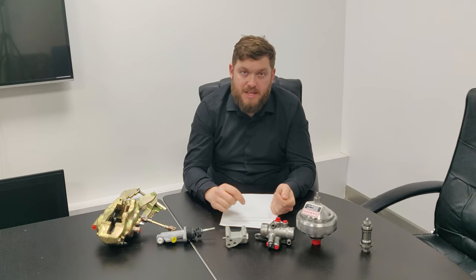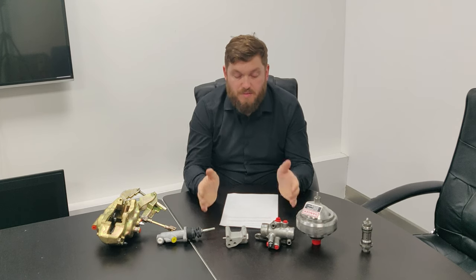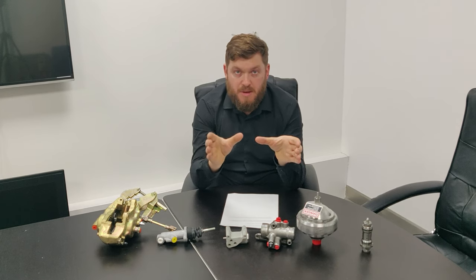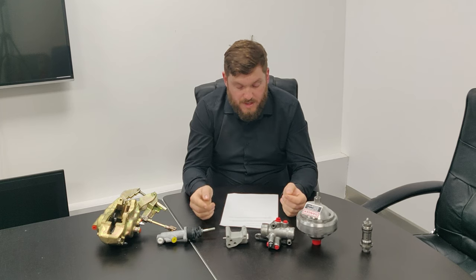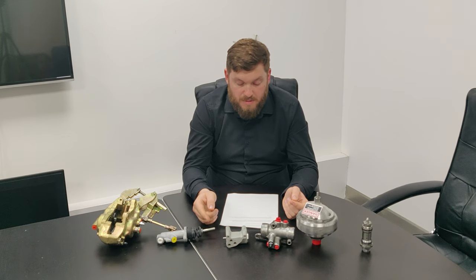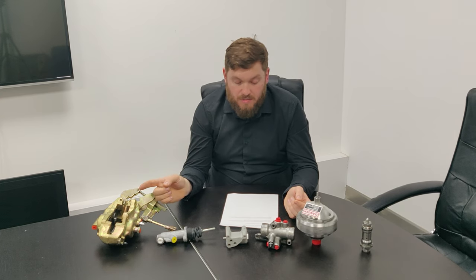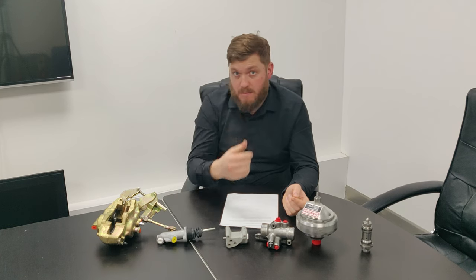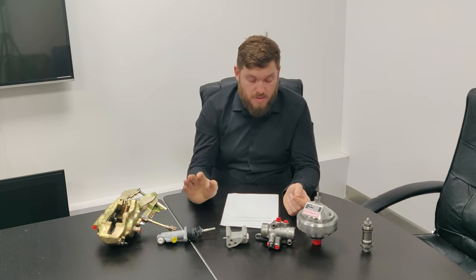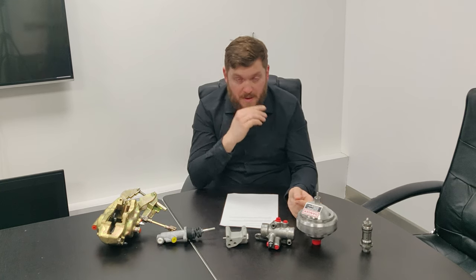There's a couple of things I've written down that might be worth mentioning. So the reservoir is split into two parts, front part and a back part. The front reservoir compartment supplies fluid for the front brake pump, the front hydraulic accumulator, the lower brake distribution valve, and the front calipers of the front brakes. And it says the lower or upper cylinders of the rear brake calipers, depending on the year of the car. So that's just worth mentioning, so that you think brake system one, brake system two, front and rear.